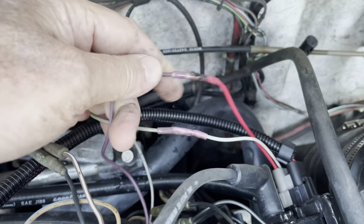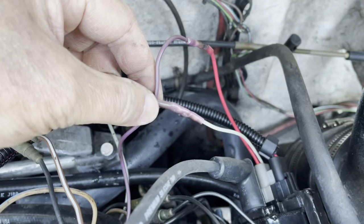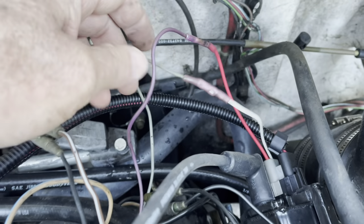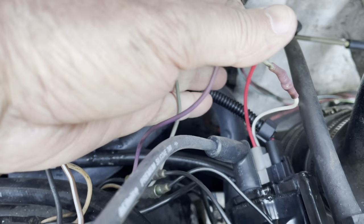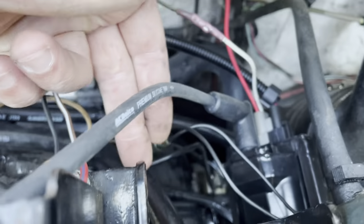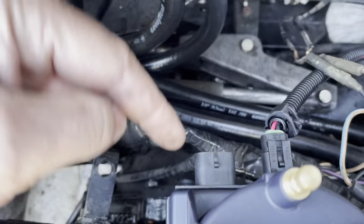The wiring is done — the boat's purple is hooked up to the new red on the ignition coil, and the boat's gray is hooked up to the white on the new ignition coil. That's it for the power and tachometer connections. I'm going to take some wire ties and tie these up to reduce slack, probably tie them off to the power steering hose over there.